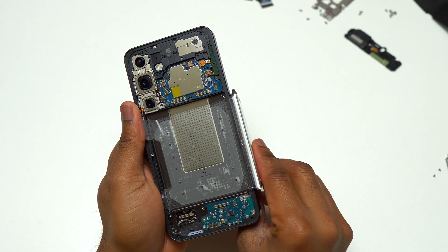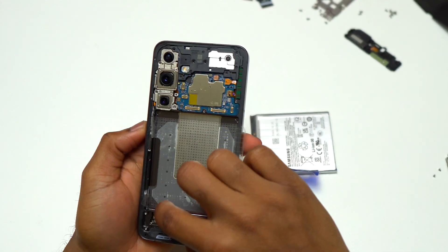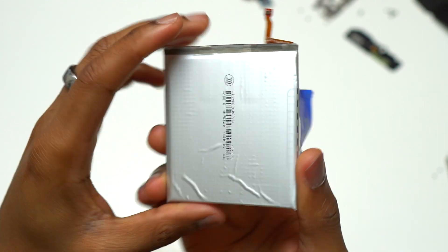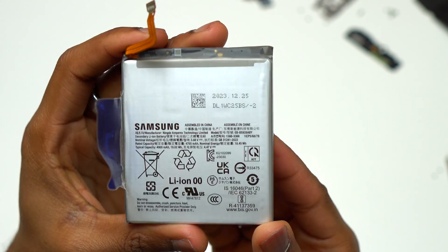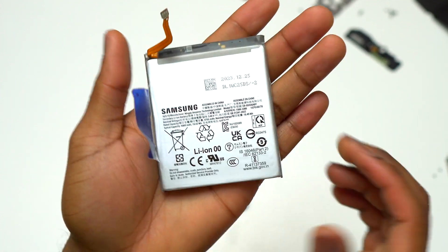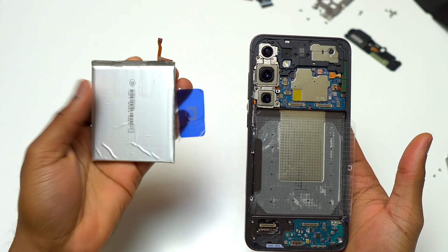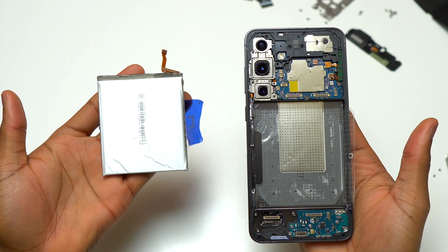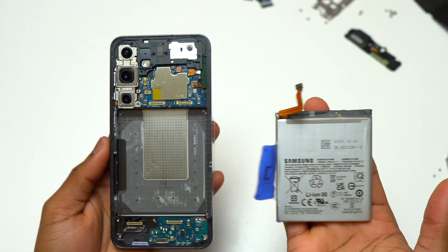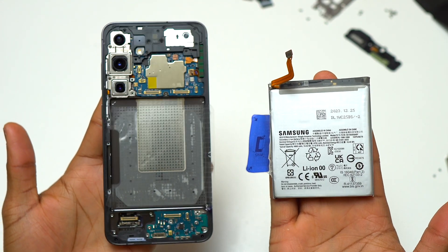After you remove the battery, if the new battery does come with a pull tab, you simply need to reattach the new pull tab and the battery inside the device. If it doesn't come with a new pull tab, remove the battery as shown and insert the new battery inside while leaving the double-sided tape already inside the frame. Then put all the flex cables back, put all the screws, then the battery cable, and finally seal the back with the back glass. You can check any of my back glass replacement videos on the Galaxy S24 Ultra or S24 for a better understanding of how to put a new back glass on the device.